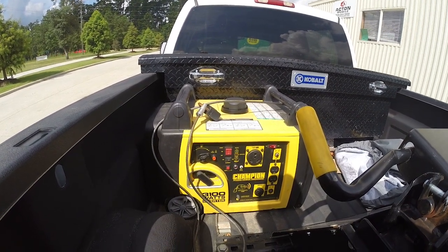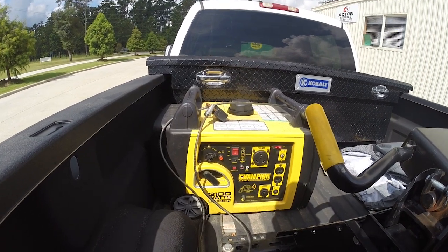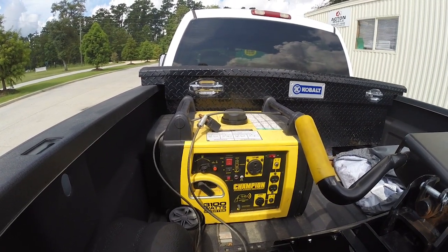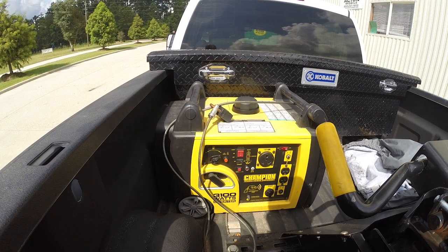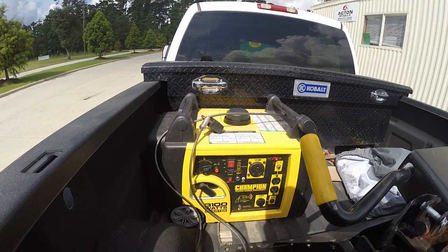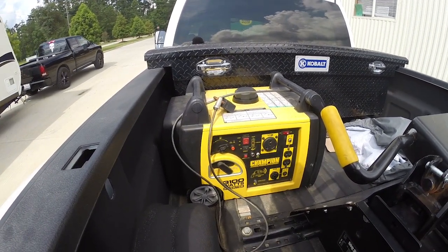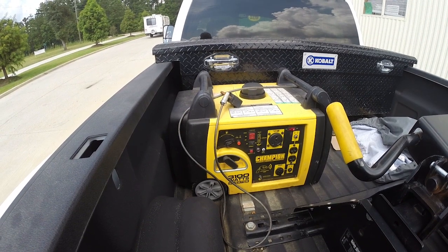Another reason why I bought this — I'm really impressed. And this is an actual test, people. I didn't set this up or plan it. Again, I'm not being sponsored by Champion. But if you ever have any questions concerning the Champion generator 3,100 watt max 2,800, put it in the comments down below. You've got the economy mode, or you can turn that off where it will run at constant RPMs to put out your maximum wattage. But with the Econo mode on, it saves fuel. Look back at my older videos and check them out. We've used this to run Maddie, our 42-foot fifth wheel — we use it to run our air conditioner and all the essential services on the rig. So check it out.